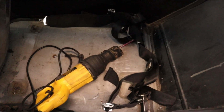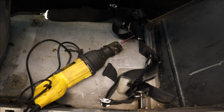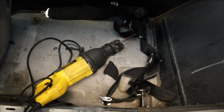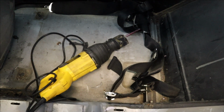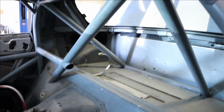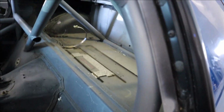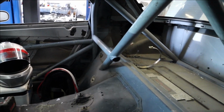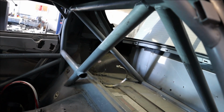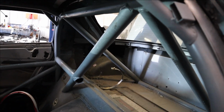Next thing to try is to cut out the floor, and the floor is 3/4 of an inch thick, and then basically my seat would be just attached directly to the cross members that go below the floor. We'd have to add some and build some and box it all in and everything. So those are the things we're going to try first to see if we can salvage what's here, because what's here is not terrible. Some of the welds aren't great, but most of them are fine. There's a few little boogers, but the design isn't terrible. It will definitely work, but we're going to have to get creative on the crossbar and the down tube if we're to make this work. So you get to watch me.